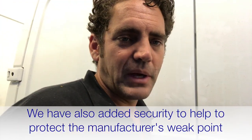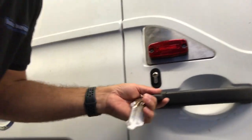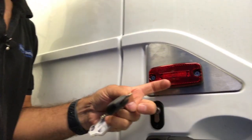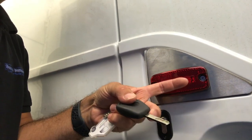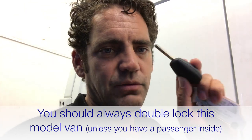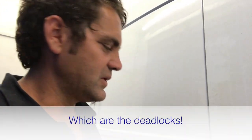Deadlocks on all four doors. Also with this back door, we've done a couple of things to secure the manufacturer's weak point. This van has a factory deadlock double-lock, but the trouble is someone can get past it either by attacking the lock on the back door or by ripping off the plastic brake light fitted here as standard. We've taken off the factory plastic brake light and replaced it with our metal blank with brake light incorporated. We've also made this lock and unlock rod redundant, so this barrel will no longer override the factory deadlock. So with double-press of your factory remote, the deadlocks go on, and the manufacturer's security is now more secure, plus you've got that additional layer of mechanical security.